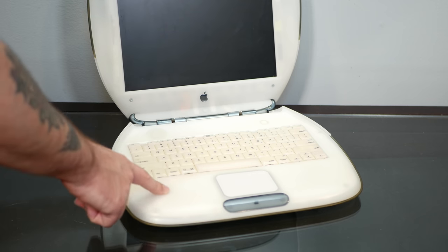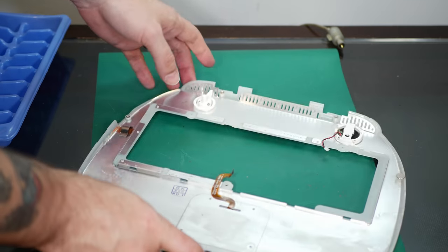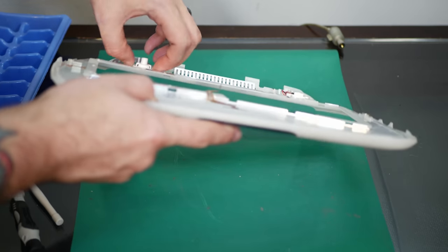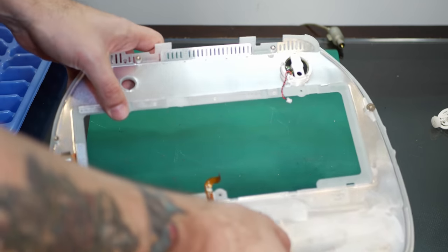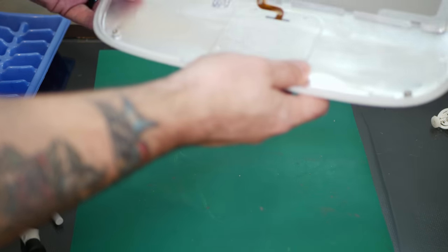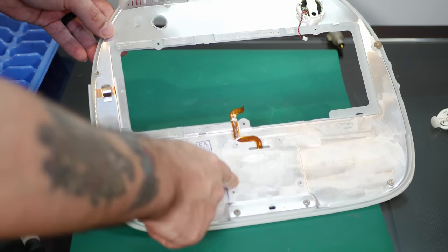Let's finish the mod and remove the shielding from underneath the top case. We just have to be careful around the power button and the speaker — this should just come out. I've read that the speaker is kind of plastic welded into place, and it does look like that's the case. So I wonder if I can cut this shielding a bit, and I'm also going to cut around the track pad to just give that a little bit of a buffer on the underside.